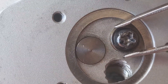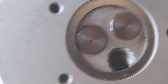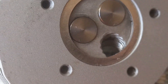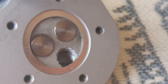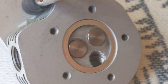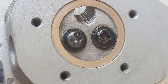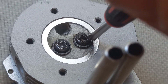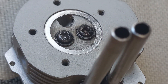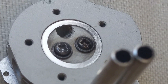That's going to be pretty good for super gluing onto the valve. The valve is slightly above the top of the cylinder, so I think this is going to be a really successful way of lapping that valve. We have the screw heads super glued to the valves, and we're going to try a bit of pressure and a bit of Jif on those.